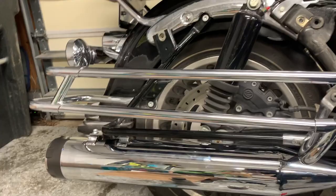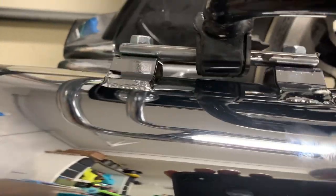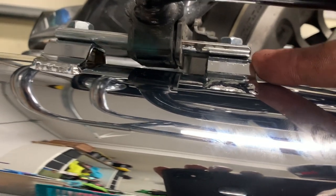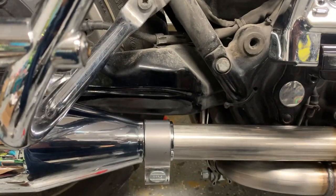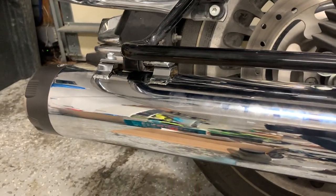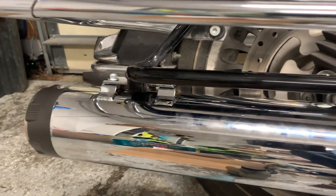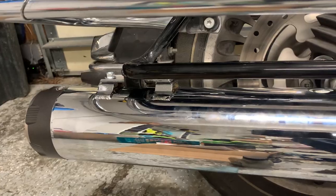The other thing I'll say is that getting this side pipe on, the right side, was also a challenge. The real reason for that is because if you take a look carefully, you can see that right here, this sticks down a bit, and this is sized well so that these little nubs are where they need to be so everything lines up properly. The problem is that when you're trying to slip it on to here, that starts interfering. If you really wanted to, you could loosen some bolts and loosen up the bracket that it mounts to. What ended up working for me was just a couple of taps on the back with a dead blow hammer. I've mentioned in another video that I really like dead blow hammers for that kind of thing because you can do that without risk of damage. Obviously you could damage if you hit hard enough, but usually it's not a problem.